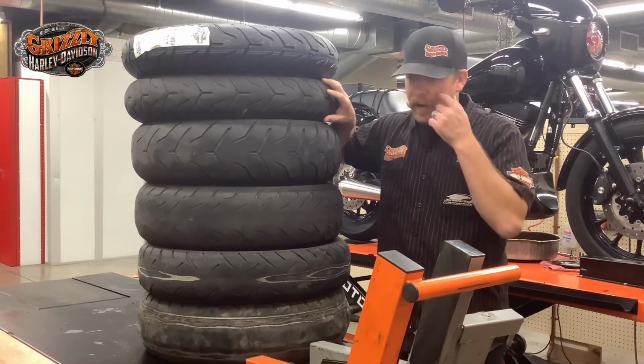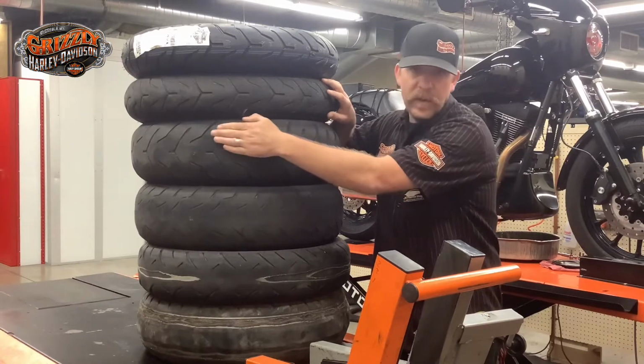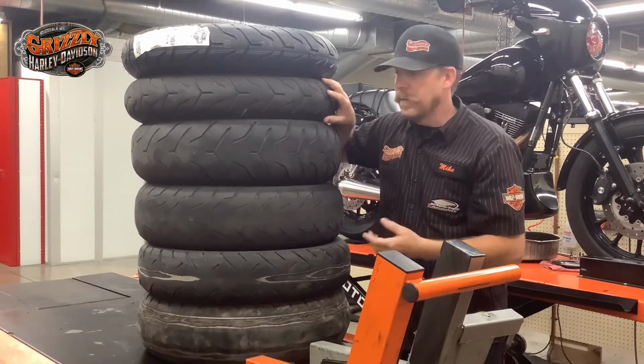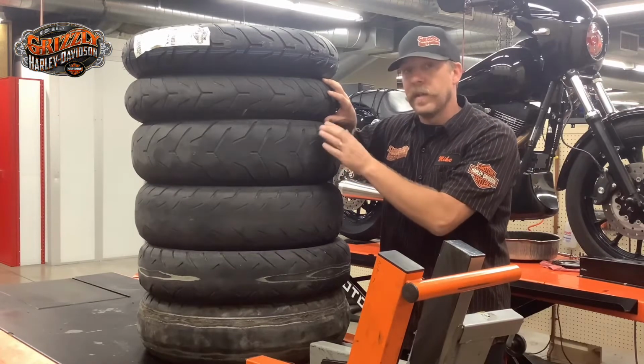As I was touching on earlier with this tire, this guy ran it on low pressure for quite a while, and I can visibly see and feel what's wrong with this tread. It's cupping and feathering, made for an uncomfortable ride. It also made this tire wear a whole lot faster. At the end, I'll show you a close-up so you can see what that did.